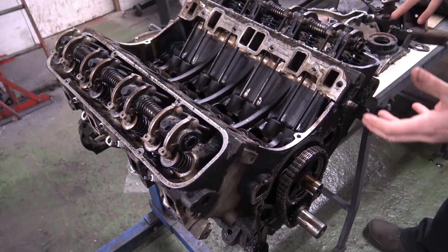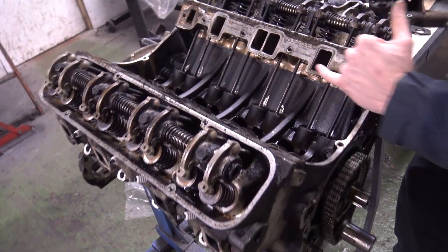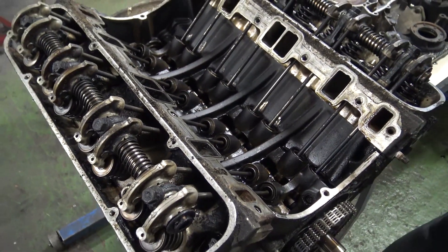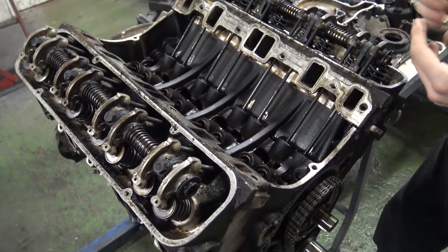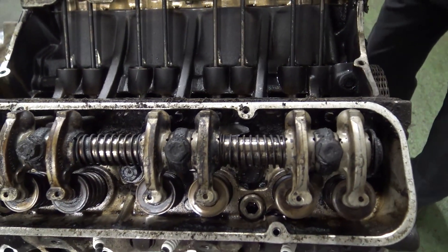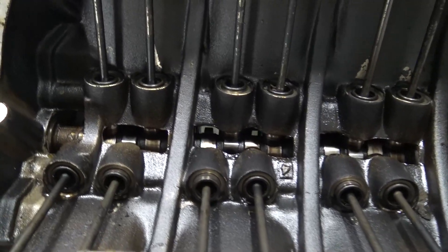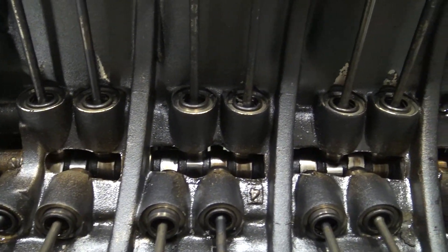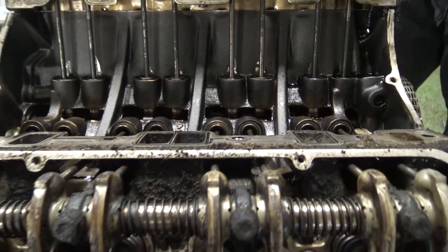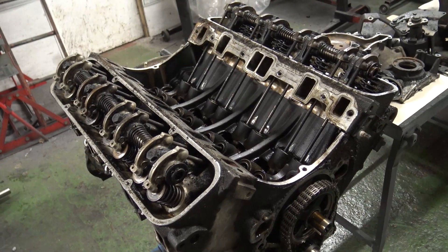This is the exchange engine — 3.5 litre, 1988. We think the heads may have been off and cleaned at one point as we're seeing a cleaner condition above the head gasket. There are still lots of carbon deposits and general dirt and grime inside the valve area. The rubber washers used for inlet valve guide seals have well passed their sell-by date and disappeared — probably into that sump. As for camshaft wear, we can see browning on the centre of all the lobes. This is the general condition of an engine that's probably covered 100,000 miles, though we've seen them like this much earlier or later — it all depends on the maintenance schedule.